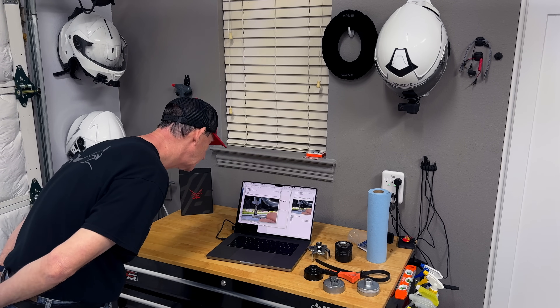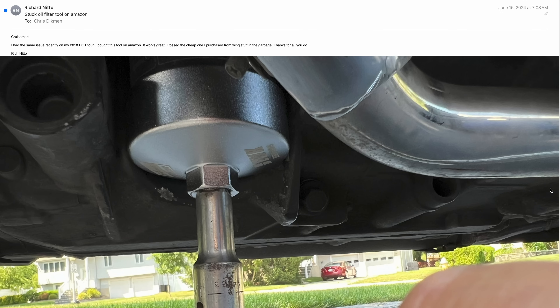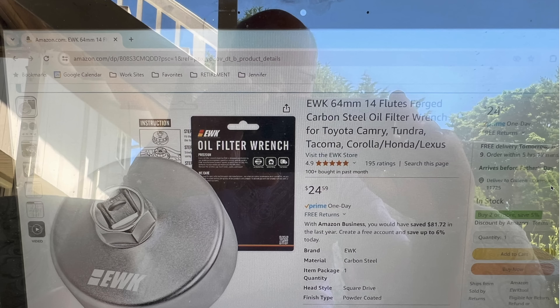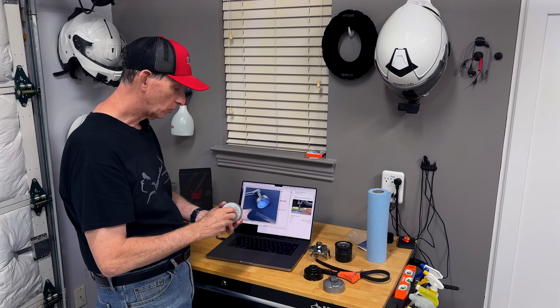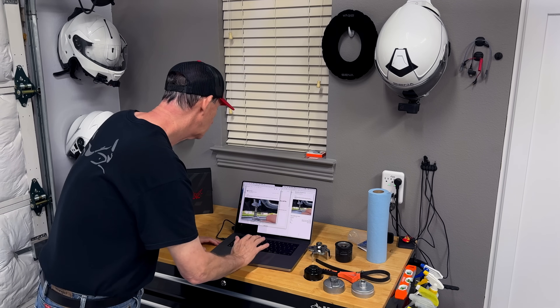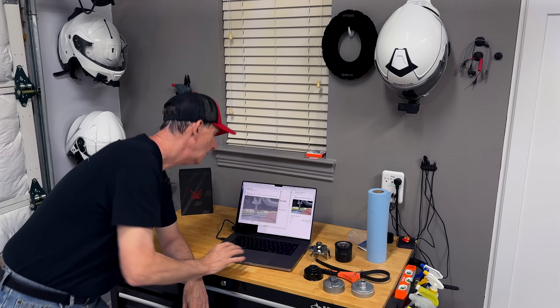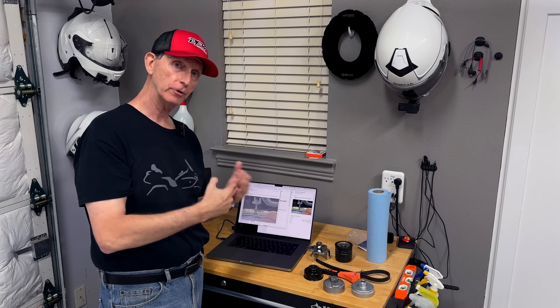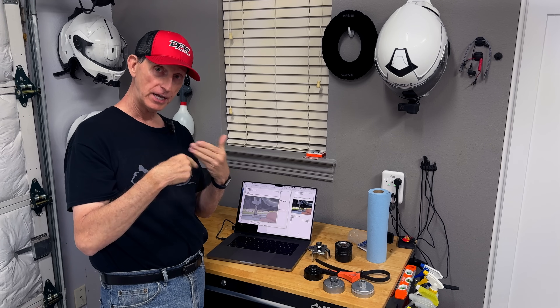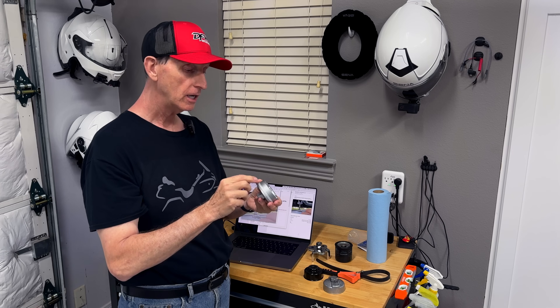This is from Richard Nitto — he said he had the same issue recently on his 2018 Goldwing and bought a tool on Amazon from a company called EWK. It works great — he threw his cheap wing stuff wrench in the garbage. It looks almost identical to the Bluepoint cup-style wrench, maybe not quite as heavy duty, but very similar. I'll put a link to it in the description. You could also drill a hole in the side of this one and add a set screw if you ever need that option.